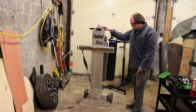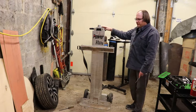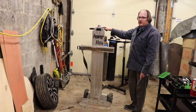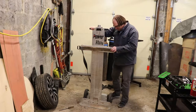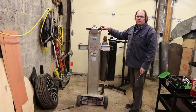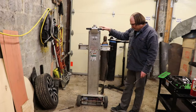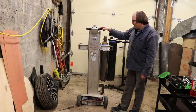The charger is missing, and the batteries are probably only good for two or three years in my experience. They're just like gel cell batteries you'd see in a fire alarm panel or a UPS — after a couple of years they swell up and don't work very well. I'm going to take these batteries out. You can get them directly from Powermate; their website shows they support their products very well and everything is still available. But since I bought this cheap, I just want to find some suitable replacement batteries.